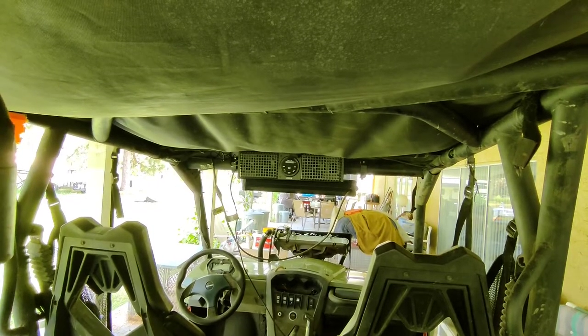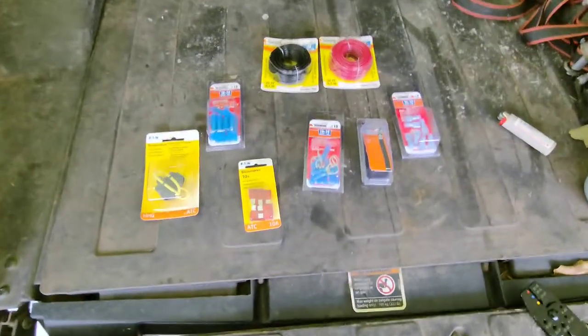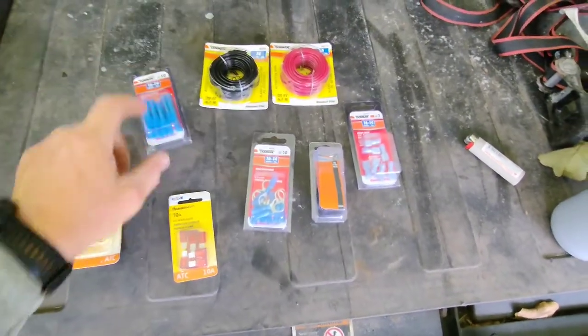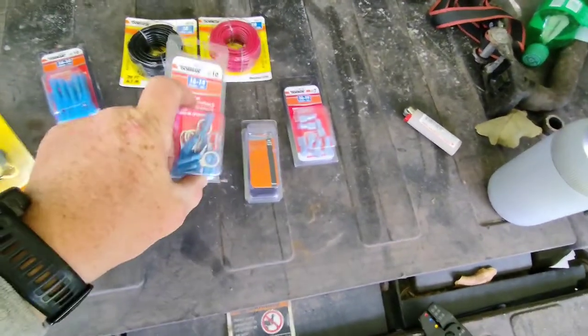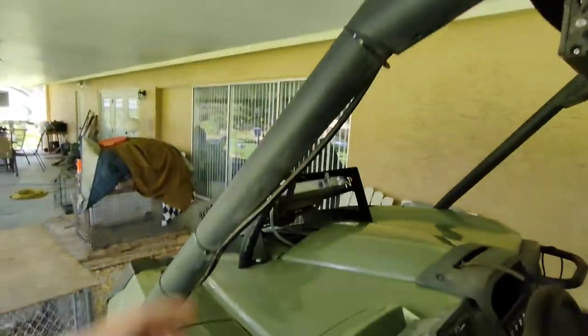So the driver should easily be able to just put their finger up, turn it on, and control it from there. Now I'm going to do all the wiring. The wiring won't make it all the way to the battery as-is, so I got some extension supplies — got my hot and ground, connectors for making connections, a place for my 10-amp fuse, a place to hook up to the battery, and a switch I can put in there. I need to run the wires from here, probably come down this way, go across the dash, and then over to the battery which is on the other side.